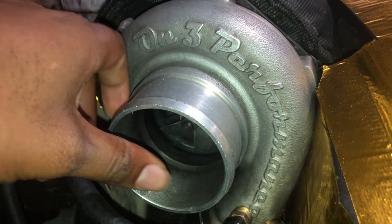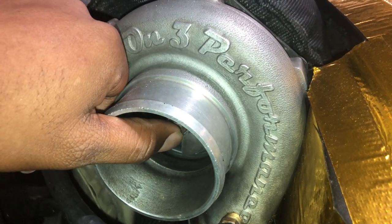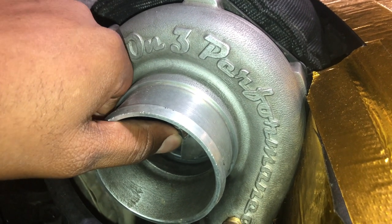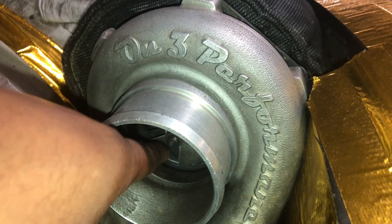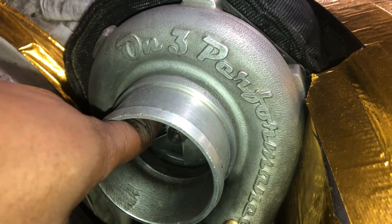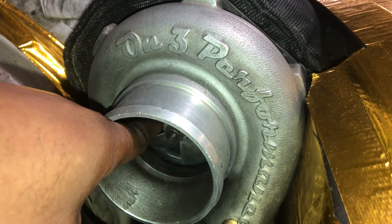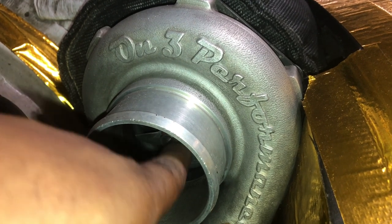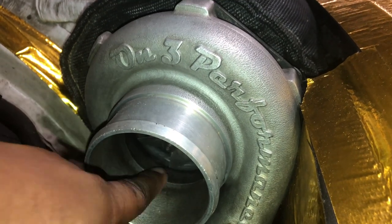I've got an update on my N54 335 single turbo — it finally went. It's not really blown, still working fine, not smoking or anything, but there's pretty much lateral shaft play on it. As you can see, I put my hand in here and you can see that play. It's even gotten to the point where it's scarred right here in the back — it makes contact. The car could start and it won't make contact, but when you step on the gas it'll pull that way and rub.